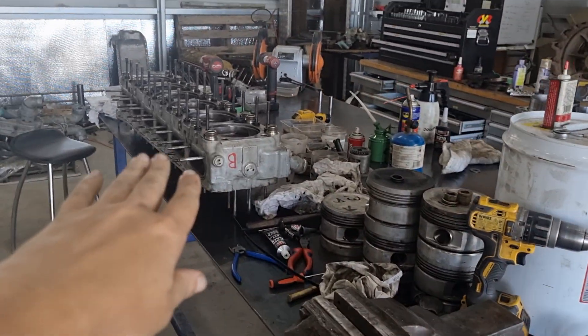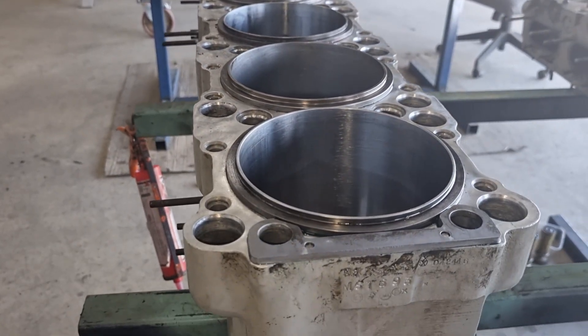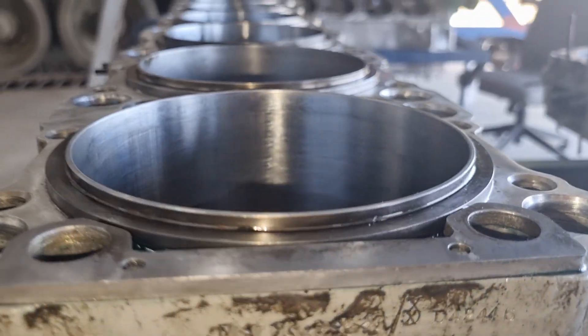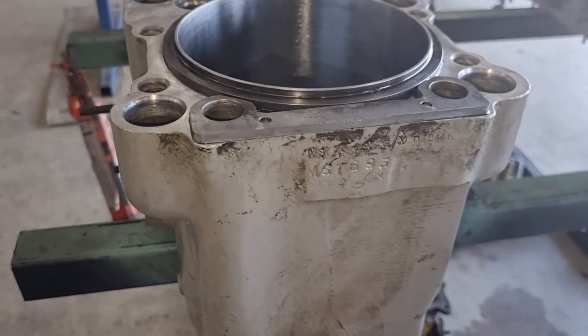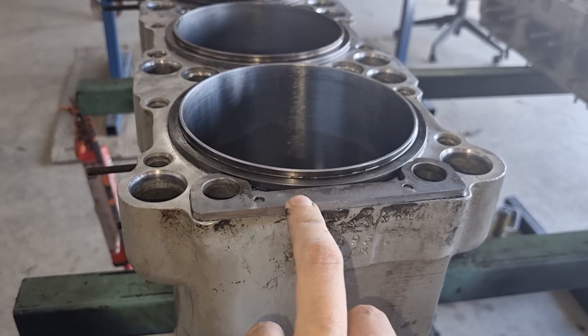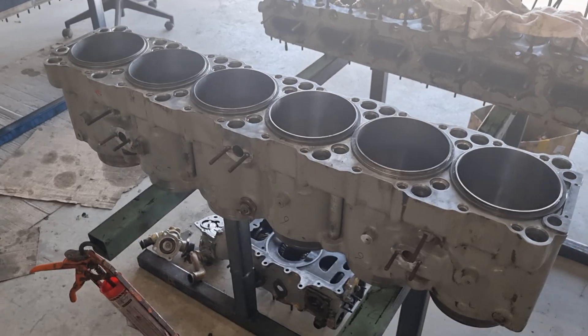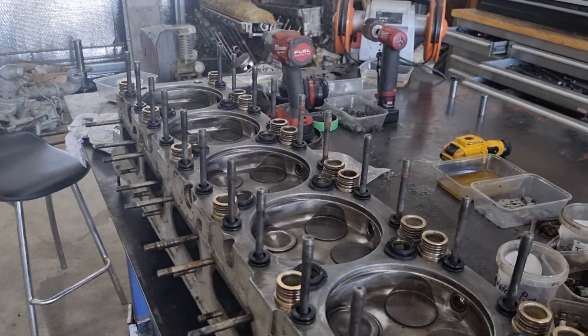Likewise on the top of the liners, that distance here is the same. What we're going to end up doing is flipping the heads onto the liners — so that will be the heads fully assembled. These liners are a machine fit, so you'll see that they are exactly the same height and they just seal metal on metal, so you need really good sealant — and that's where the anaerobic sealant comes in again. So we've put that one on, letting it dry, and we've got this one going on too. There's a lot involved assembling these engines and everything has to be perfect — that's where all the time goes. But it does look quite nice when it's all assembled.